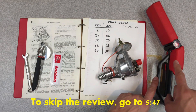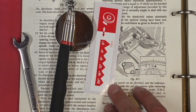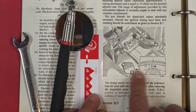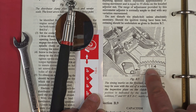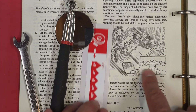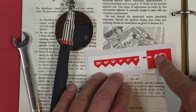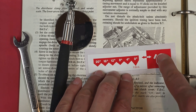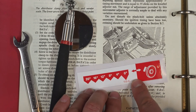Whether you have an A-series or an A-plus motor, there are timing marks. On an A-series motor the timing marks are hidden behind a little plate. The 1/4 is top dead center, the 5 and the 10 are degrees before top dead center. On the A-plus, the timing marks are attached to the timing cover itself on a little plate, so we'll be able to see both.